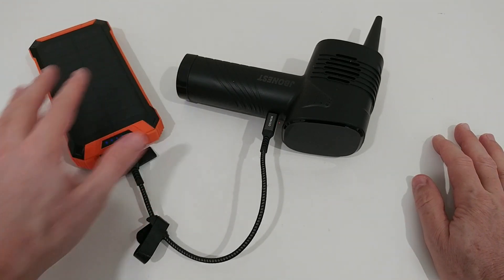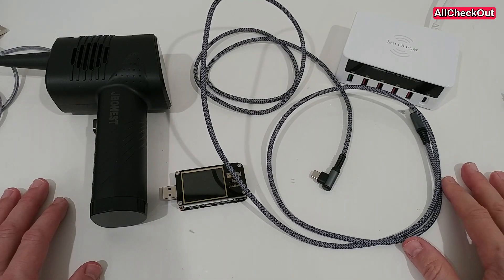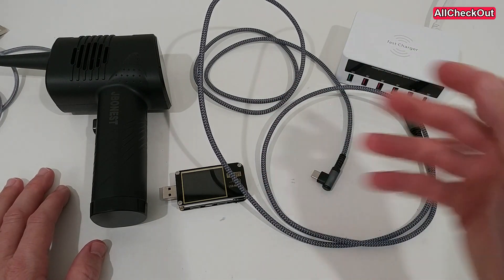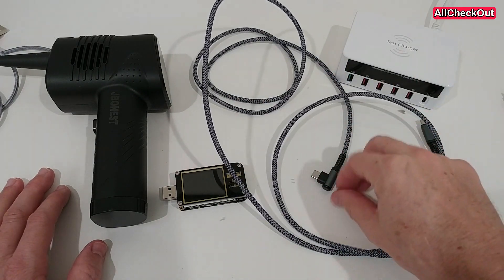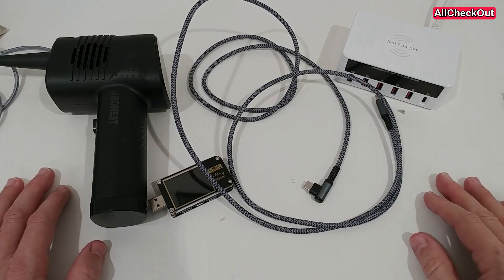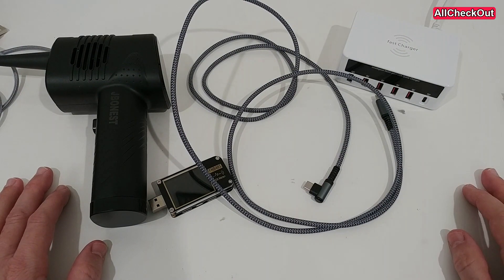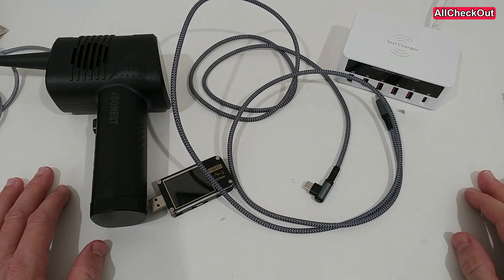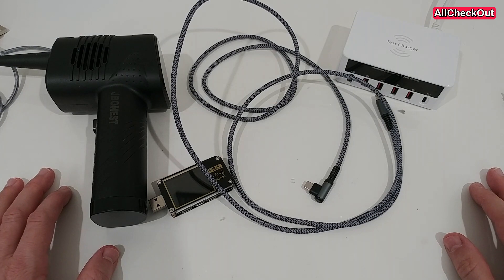At the moment we have to deal with this situation. Usually, USB to USB is very easy — you can plug almost everything into everything as long as the plugs fit; the amps and voltage are automatically adjusted and you don't have to think about anything. But not USB-C to USB-C — that's the one thing you have to remember, and that's the reason I wanted to make this video.